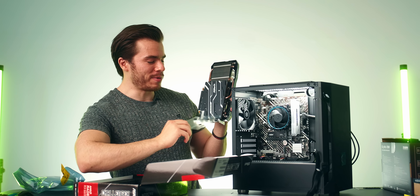To install the graphics card, first remove the PCI slot cover on the back of the case and open the latch. The topmost PCIe slot will populate the two middle bracket slots, so remove those covers. Before installing the GPU, let's put in the Wi-Fi adapter on the bottom slot — remove that cover and seat it. For the GPU, line it up with the topmost slot and press it in all the way until you hear an audible click.